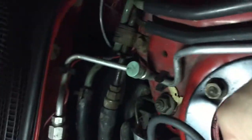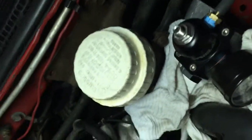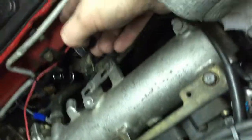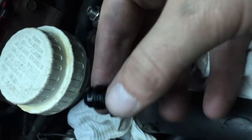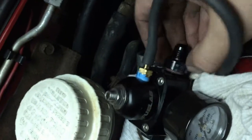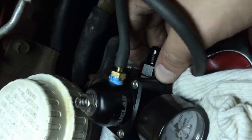The original plan was to take that bracket and mount it in the corner where that bracket was, but it knocked into our brake fluid reservoir. So we're moving the connectors around and mounting it back where that ground wire is now, swapping the ground wire over to where another bracket was previously. I'm using an old shirt to soak up all of the fuel that was in the regulator. Now I'm inserting the 6AN fittings on the opposite sides to match where the new mount is going to be.